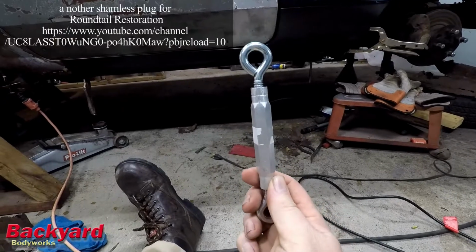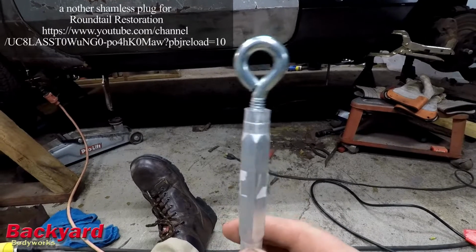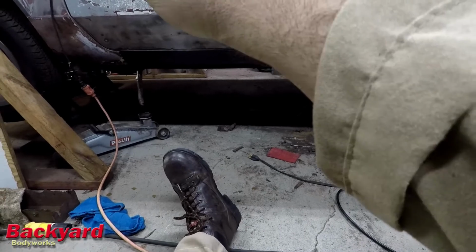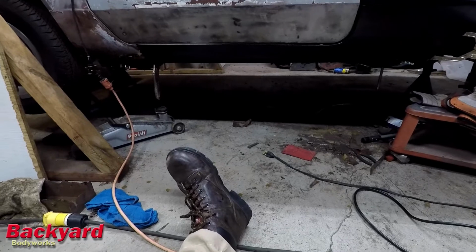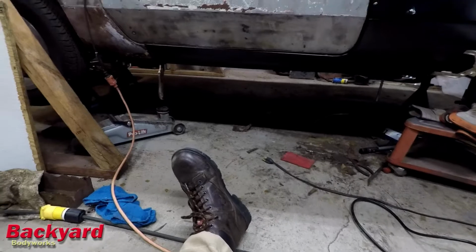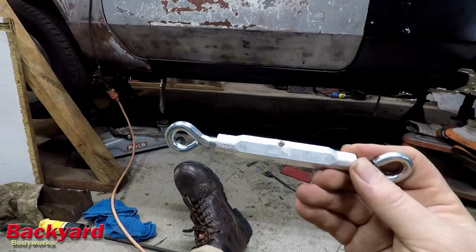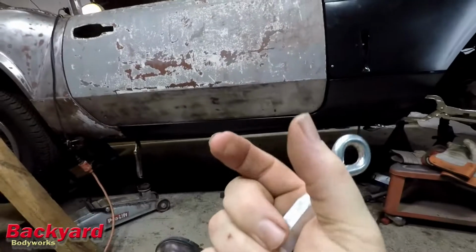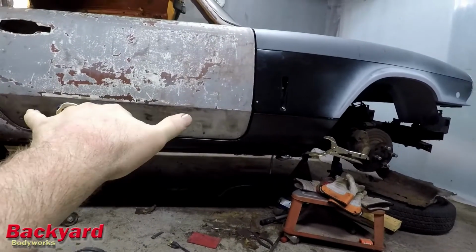Chris Fisher, in one of his videos, when he was doing the driver's side, I believe, had a turnbuckle on the support piece that went across the door frame or the door opening. And I thought that was ingenious, as far as setting the door gap, because you can adjust this by turning this middle piece, and it would spread apart, opening up that door frame.